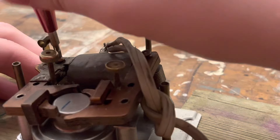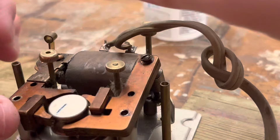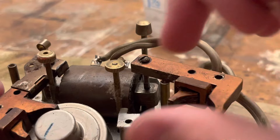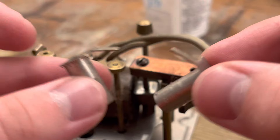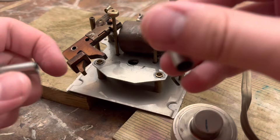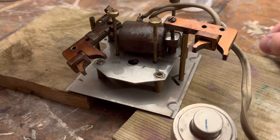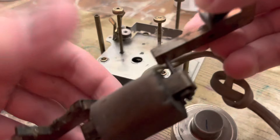Let's get the camera in closer and undo this screw here. There are no washers on this side - not sure why that is. Okay, this guy pops out of here, there's a slot for that. There's a support under here - there are two of them, supports underneath. Okay, I'm going to take that apart for now. We're going to take our coil assembly out of here. It looks like our movement's already riveted together just by looking at that. There are nuts and bolts here.